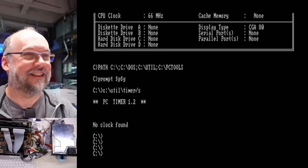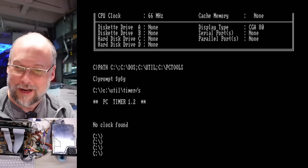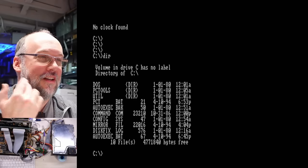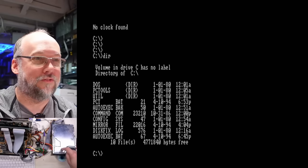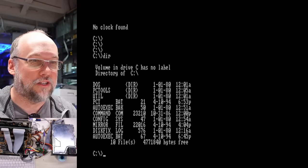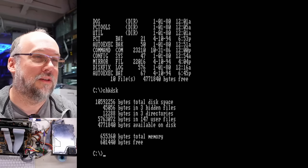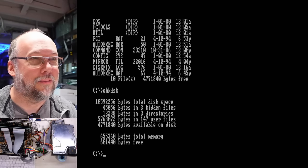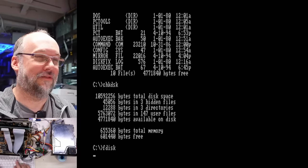There it is. Looks like we have — I think the model number was 252 on this drive, so probably 50 megabytes unformatted. If we do check disk, it should tell us the capacity. Okay, formatted capacity is 10 megabytes. So it's smaller than I thought. We'll see if F disk is on here. Compact personal computer — so is that where this came out of? List partitions. It says 304 cylinders. That can't be right — the drive has to be bigger than that.